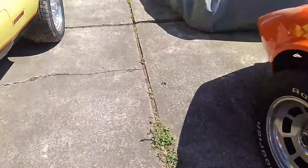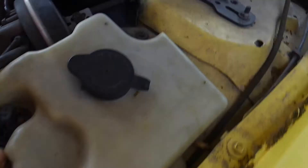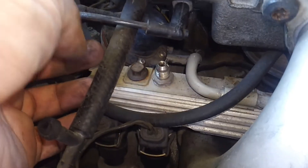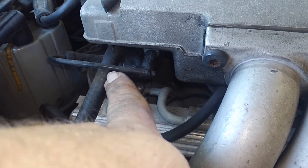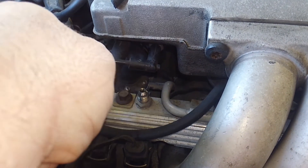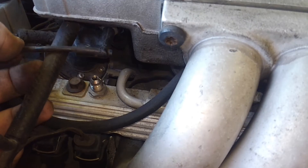So you can see the difference across just a few years based on what the cars were using. My Formula does have cruise control — I just wasn't seeing the signal line; someone had disconnected it, so it doesn't work. Looking at these vacuum lines, while in theory they were a really good design and sturdy, they don't hold up very well with time. What confuses people when putting them back together is how to run the lines exactly. Just remember that depending on what year you have, these are going to serve different purposes, and there's also a vacuum signal that feeds into the MAP sensor to help control the EGR valve.